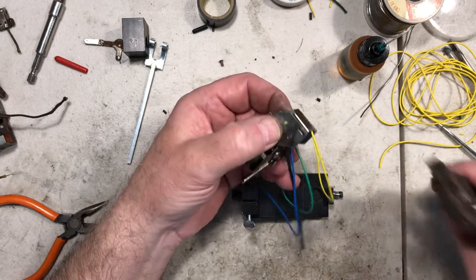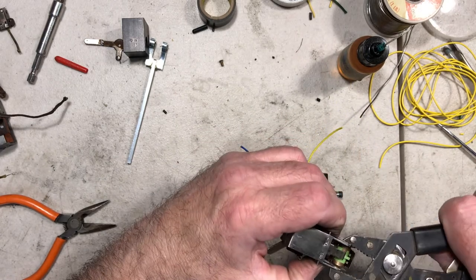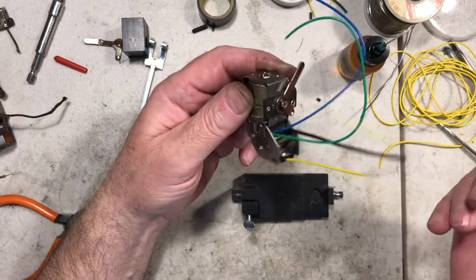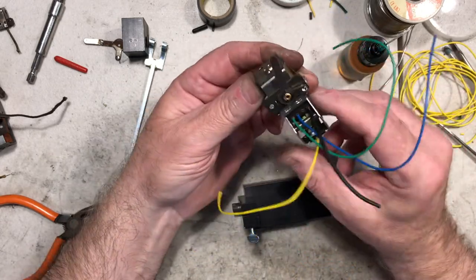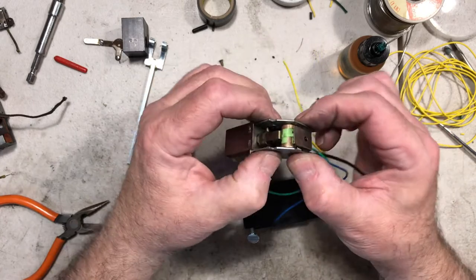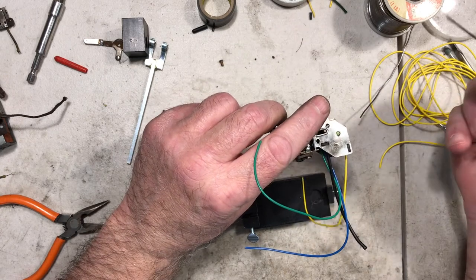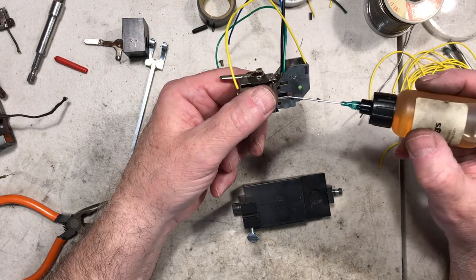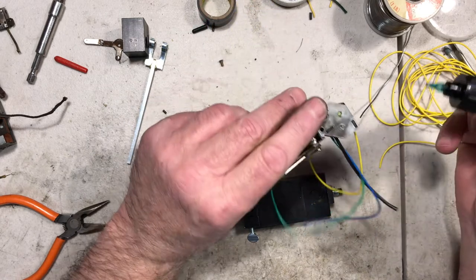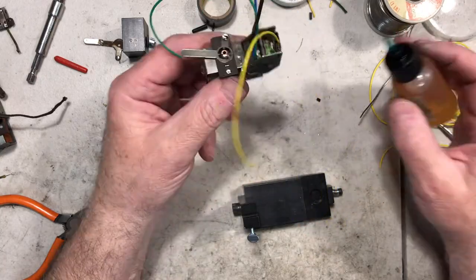You're going to keep a little tension on it — that's when you're going to need a couple of hands. You want to get this ready to go. You have to line up and make sure that the bottom finger unit is where it needs to go, back in the slots where it belongs. We have the drum unit in, two fingers, both tabs as you can see — the slots are solid. Just squeezing it together, they kind of snap in. But I'd like to gently put a little channel lock on it and give it a little squeeze just to make sure everything seems secure. You don't have to put a lot of pressure. And that's kind of it.